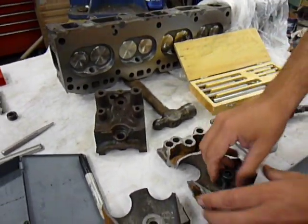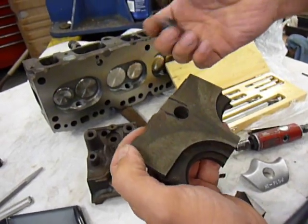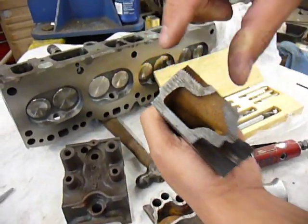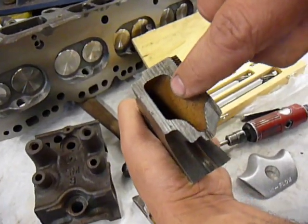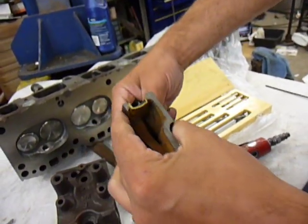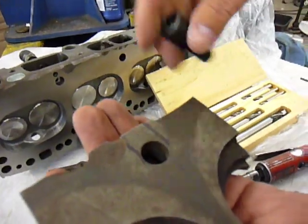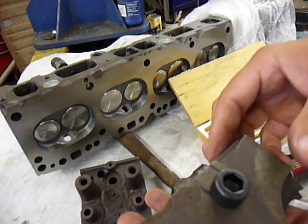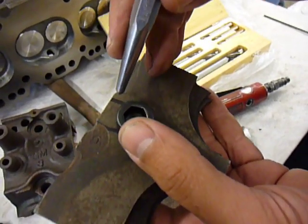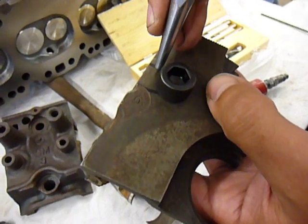The next thing you'll want to do with your head — you want to take your head bolt and mark the location. You can see the lines I have drawn on here. You want to keep your bolt inside those lines. If you go outside of those lines, you can see in this picture here — you can hit water. This is your water jacket, and there is water in this area of your head on both sides. So keep your hole between those two lines and you'll be safe. Put your bolt on the face side of your head — the head surface where it touches the block — and use it as a reference to mark your bolt hole location. The bolt can go anywhere in between; I don't like to put it in the middle. I like to put it closer to the side, halfway between the edge of the head.